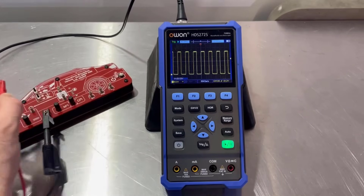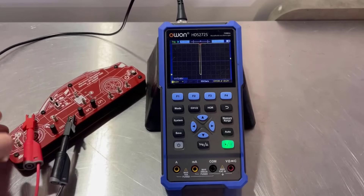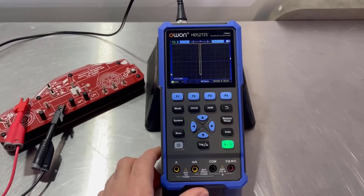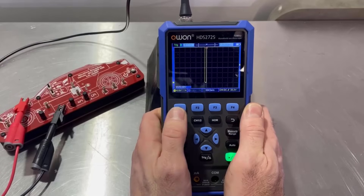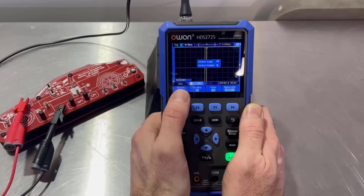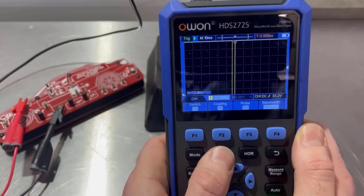Let's move over to an injector, which we've got here. We've gone onto the injector pattern and we can see that we've gone off the screen. So to get back to the voltage settings, we need to go to channel one, channel two, select that we're on channel one settings — we can see that there. If you press it again, it goes to channel two settings.